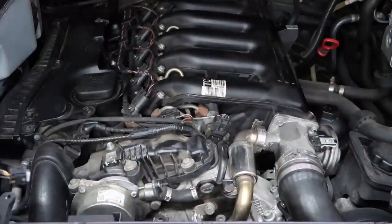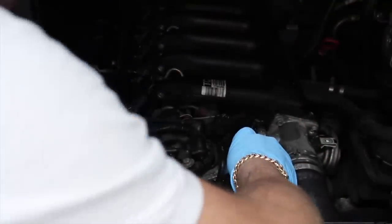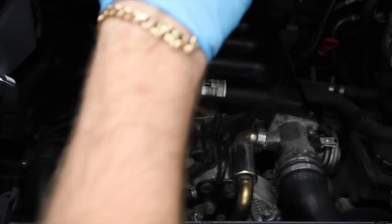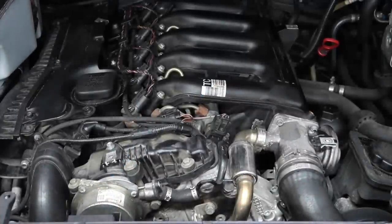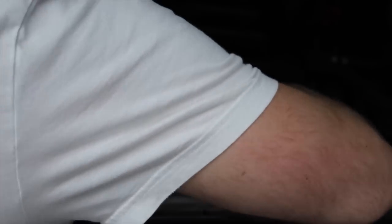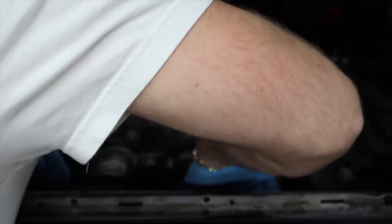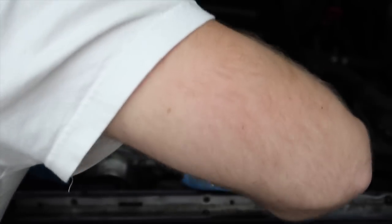First thing I'm going to do is disconnect all the connectors in the engine bay and move them to the side. Now we're going to get the spanners and release the viscous fan. When you go down here you want to be careful that you lock it on correctly. As you see there, we just released it with the two 32mm spanners. Now we're going to spin the fan off — we spin it to the right because it loosens to the right and tightens to the left on these.